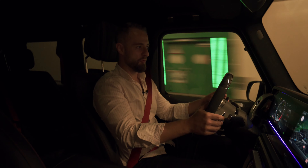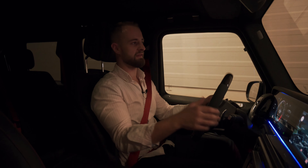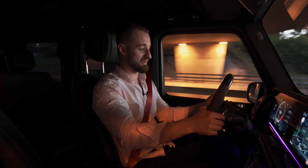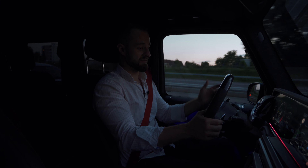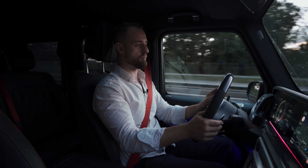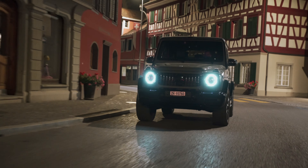It's such a big car with so much power — 850 Newton meters of torque — but still after 100 kph you can really tell it has so much wind resistance, it's really not a fast car in the traditional sense. It tops out at 220. It's incredible how they made it perform like this given how big it is. Interestingly, on the autobahn we're in ninth gear revving at just 1,100 RPM at 100 kilometers per hour.